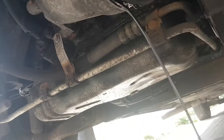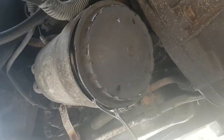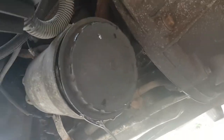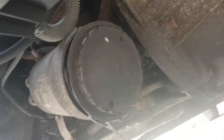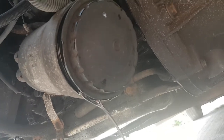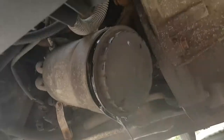Still draining out. The sump plug is just over there, which is what I'll take out next. It holds about six point something litres, so what I'm probably going to have to do is drain this out — drain about five litres into this — because I don't think 6.5 litres plus the filter oil will all fit into my one pound washing bowl from the pound shop.